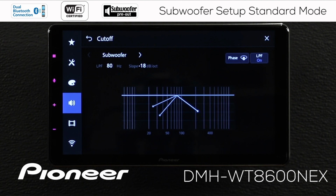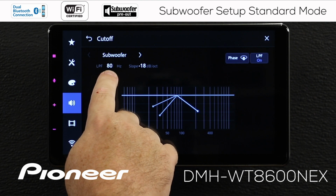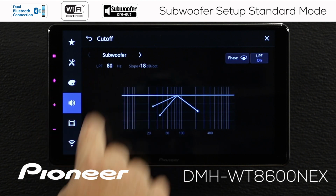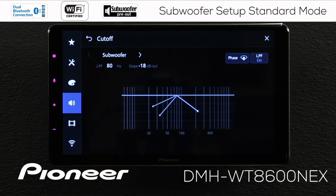There's 18 decibels per octave, and what that means is my subwoofer is going to play all the frequencies below 80 Hertz, and above 80 Hertz, the volume of my subwoofer is going to roll off at 18 decibels per octave. So 1 octave higher would be 160 Hertz. The volume coming from that subwoofer will be 18 decibels less than it is at 80 Hertz.